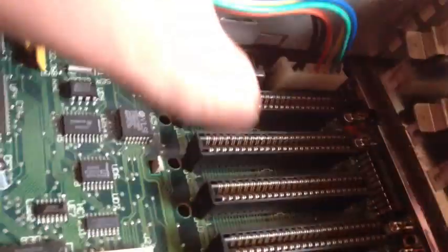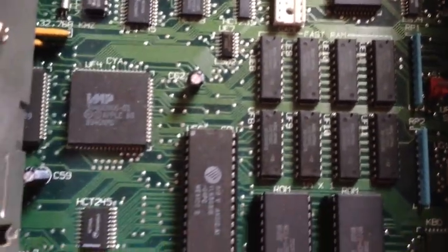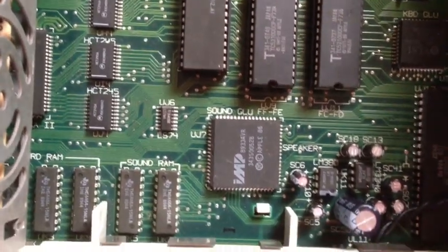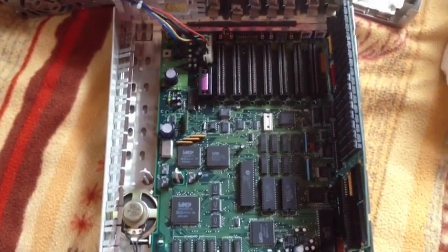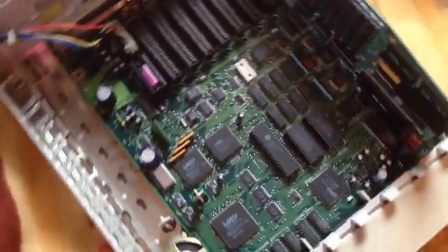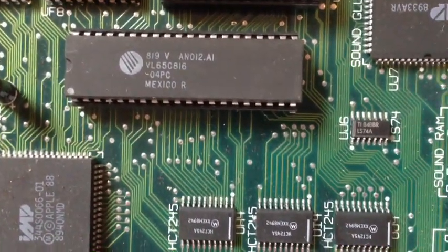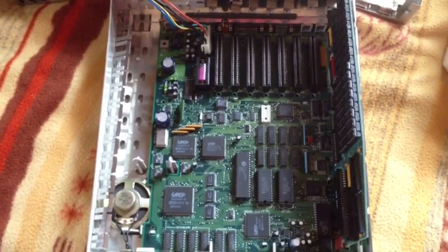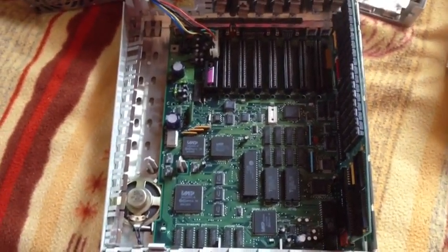Here's a big difference on the ROM 3 as compared to the ROM 1 — a replaceable clock battery. And you have your cache RAM, fast RAM, your 2GS ROMs, sound chip, sound RAM, and then the standard RAM. I'm going to pop the power supply out just so you can see — there's the heart of the machine. The 65C816 is a 16-bit processor made by Western Design Center. I'm going to let this acclimatize for quite a while because it was sitting on the porch — it's 21 degrees outside — and then I'll boot her up.